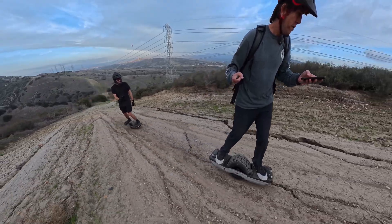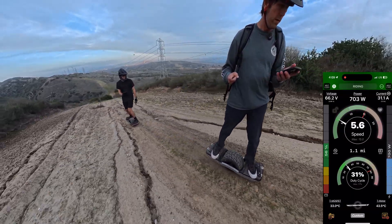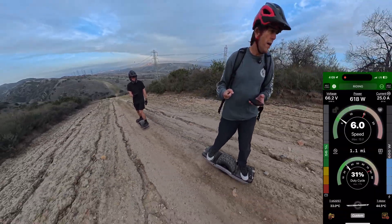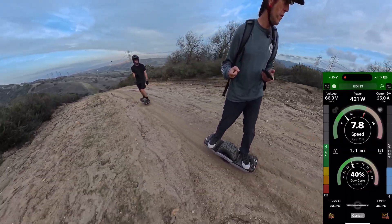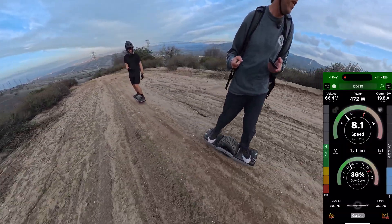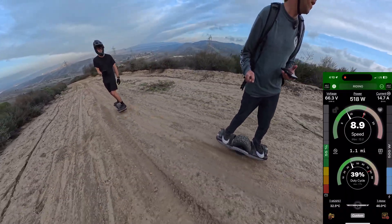Let me screen record the float control data here — I'm at 44 Celsius. Naturally one would expect the HS motor to heat up a little quicker than the HT motor, simply because you need higher motor amps for the same torque. And that's also what we've seen with the 6-inch Superflux motors. But so far the difference doesn't seem to be too big.